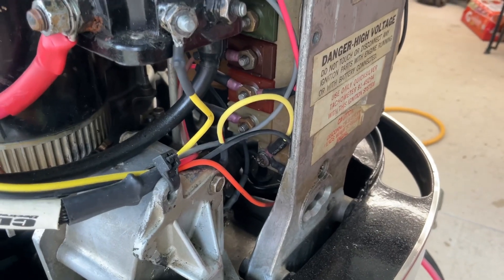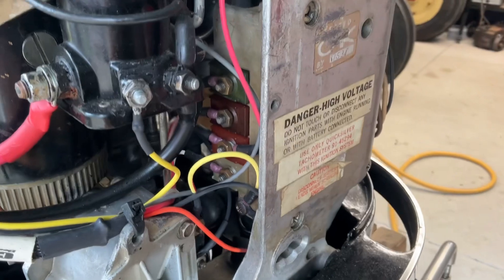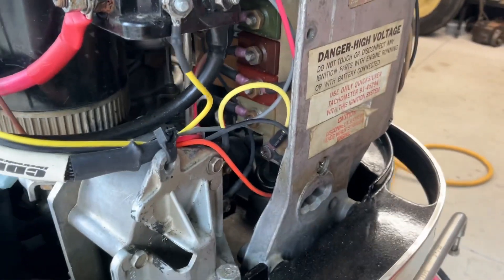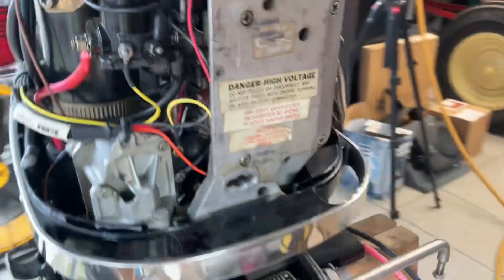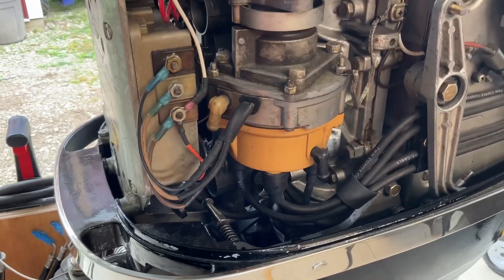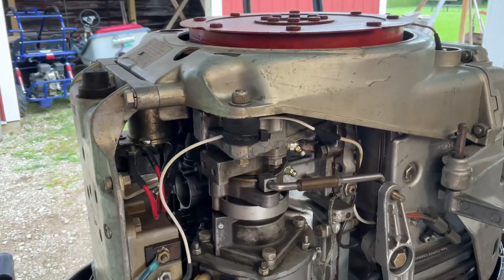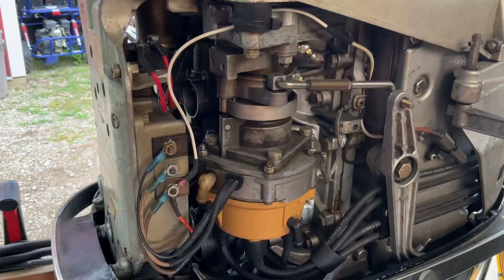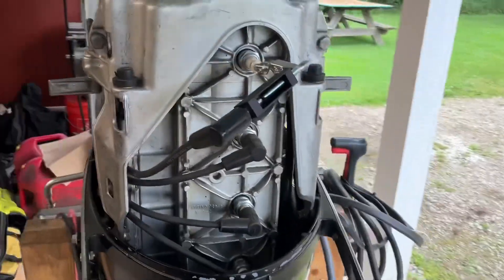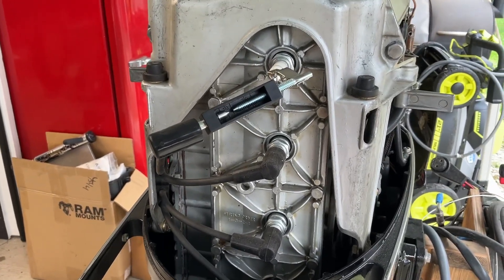As soon as you put positive on those two, you've got your coil hooked up appropriately. So the black wire and the ground to your coil, and then the three trigger wires hooked up over here — that ignition system will work on the bench. You can spin the rotor, and as long as you have a spark gap hooked up going to a common ground, that should theoretically spark.